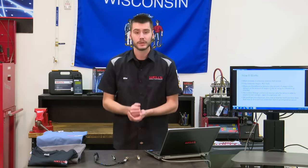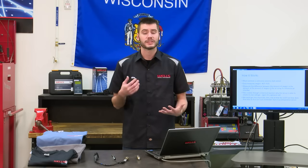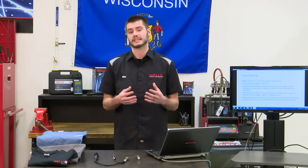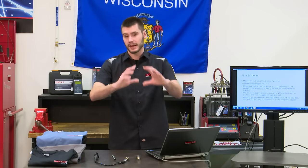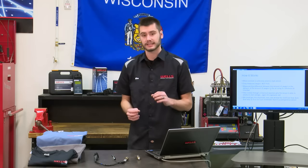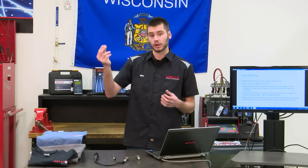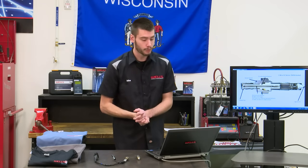Now, I could get into chemicals and ions and all that stuff and all this chemical reaction transfer, but does it really make a difference to us diagnosing cars? All we need to remember is that it's a comparative style sensor. We have a mixture flowing past our oxygen sensor inside of our exhaust. Our sensor reads the oxygen content in there and compares it against the oxygen content that is in our reference air chamber. So here's a cutaway of a one-wire sensor.